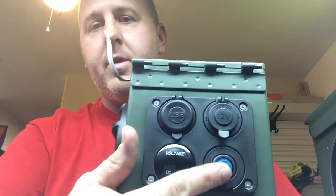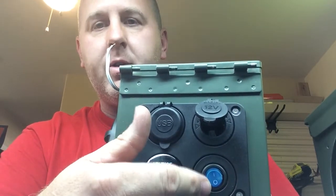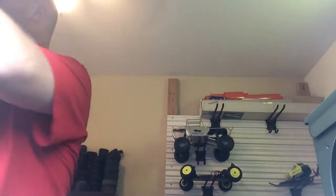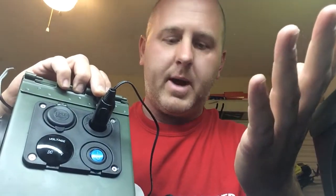One of the other things I've been using are these power panels. They come with a power switch, a voltage display, a USB port, and a 12-volt accessory plug. I've been wiring the accessory plug direct to the battery — not switched — and using it to charge the batteries. My suggestion is to use a 12-volt half-amp battery charger, available on Amazon. I went ahead and soldered a 12-volt accessory plug onto it, so when I'm ready to charge I just unplug and plug it in. Because it's a smart charger, it knows when the battery has peaked and will shut off so it won't overcharge the sealed battery.